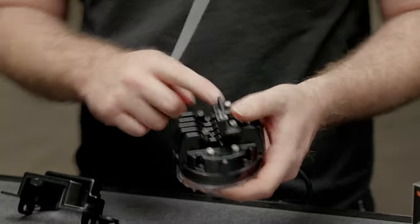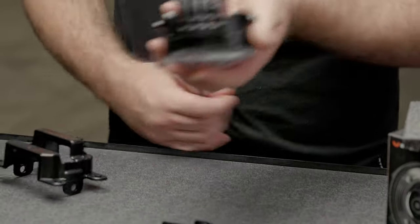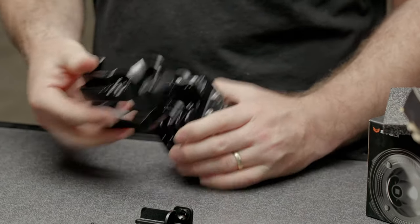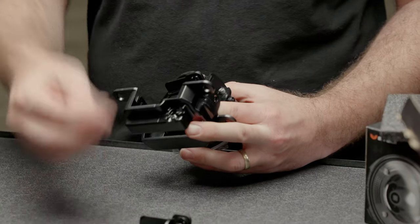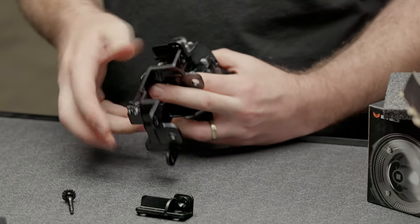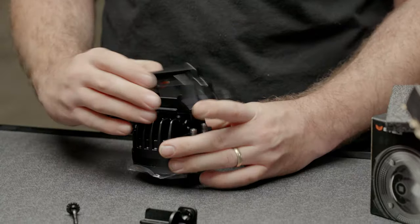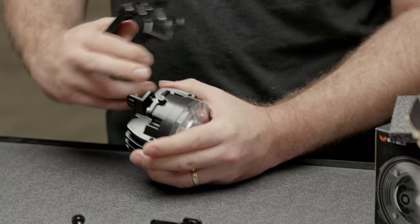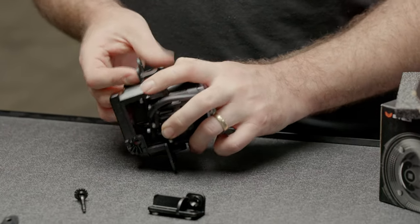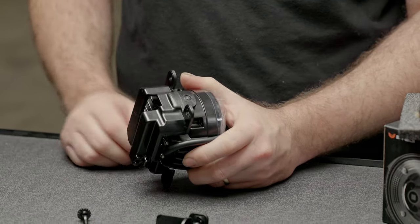Time to offer the cage to the boost driving light. The cord needs to exit from the side where the adjustment screw will be — there is a little recess here, and the other side is just straight across, so the recess is for this cord. On the side, your pivot lugs need to line up with the females. Just stretch it, get one side lined up, stretch the other one across, and click that into place.